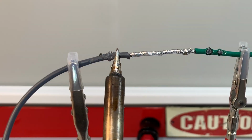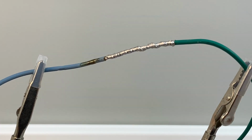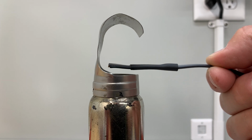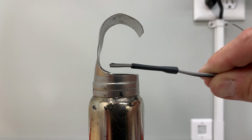You can also see the rapid damage that a soldering gun or soldering iron can do to GPT wire, while the crosslink wire shrugs off the roughly 700 degrees Fahrenheit heat despite prolonged contact. And finally, here we have a heat gun set to approximately 200 degrees Fahrenheit for heat shrink use, and I measured that with one of those little laser thermometer things, and it was running at about 190 to 205 depending.